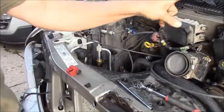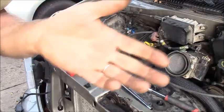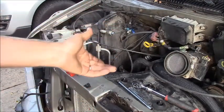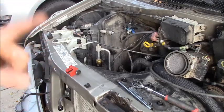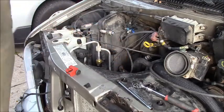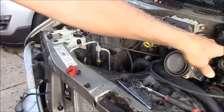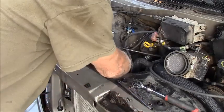Total change of plans. I've been trying to get the fittings and stuff off the rear evaporator. Everything is seized up so bad I'm going to have to cut pipes and replace a whole bunch of lines. So I've decided I'm just going to eliminate the rear evaporator because this is just used as a cargo van anyway. What I have to do is cap off the lines that go to the back. Here's the T, there's the line that goes to the back. I bought some caps — they're $40 a piece. But what I'm going to do is cut this line right here. That's what goes to the rear down and across. And the return comes back up by the back of the pump. I'm going to cut that one off. No guts, no glory.